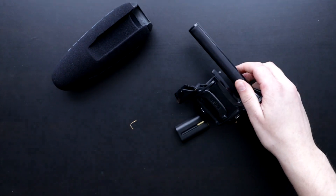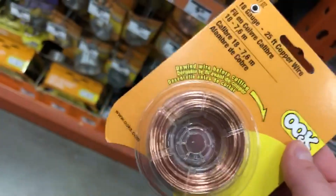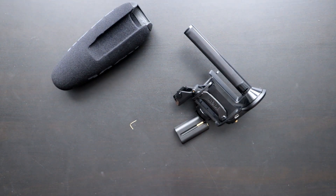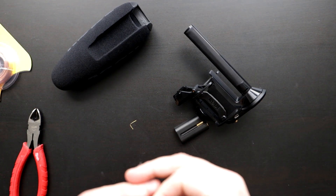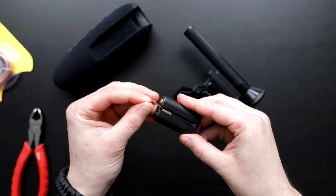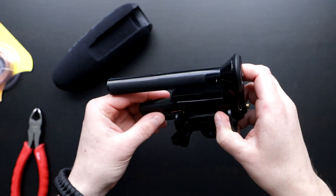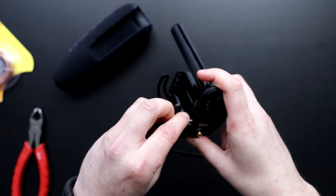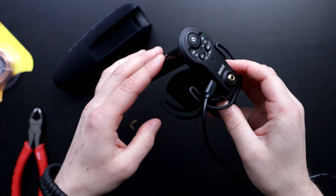To fix that, I went to Home Depot and bought some copper wire — about $6. You're just going to cut off a piece and make an L-shape with that wire, so it should look like this. Take the battery and seat the copper wire on it so that the copper wire is touching the copper on the battery. Then just slide the battery into the battery compartment, close the cover, and go ahead and plug it in. Now you can see it's flashing a solid blue light, so it is recognizing the rechargeable battery.